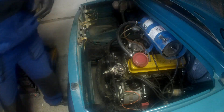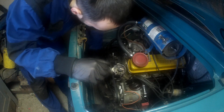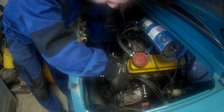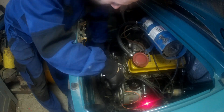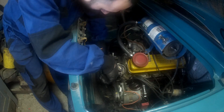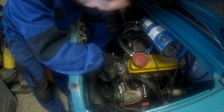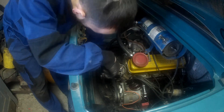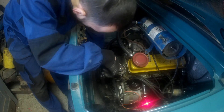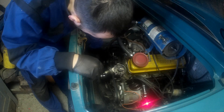To demonstrate how the Gotronic ignition works, I remove the distributor cap and turn the engine by hand. The moment the LED on the AT011 module extinguishes is the moment the spark fires. The Gotronic ignition, compared to other electronic ignition systems I have tested, is the only one capable of firing a spark when the engine is turned by hand. Most electronic ignitions require at least 150–200 RPM to do this. I will increase the volume so you can hear the spark.